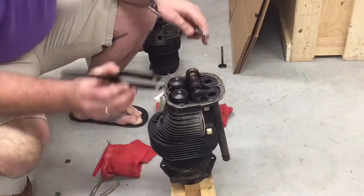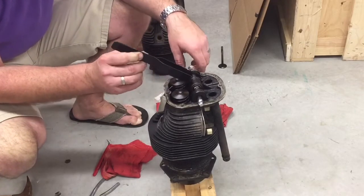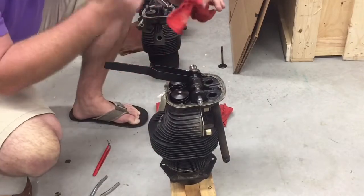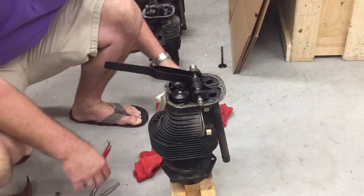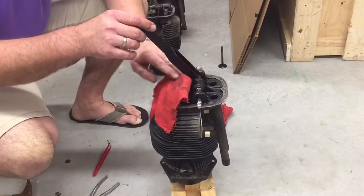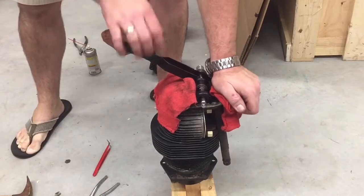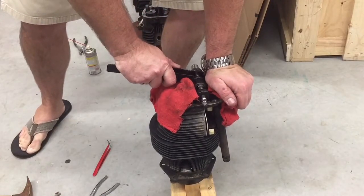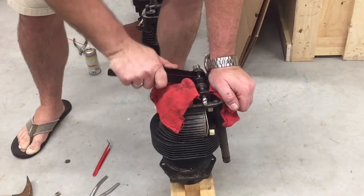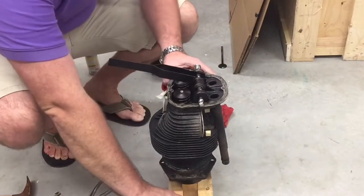Let me turn this around so we can see a little better. You take it, stick it down in here, and just slide the extension right on through like so. What this is going to do is push down on your valves right here on the lifter spring. I take a rag and keep this sharp edge of my tool from scratching up the top, and then you'll hold down pressure on the left side and push down with your tool until you hear it pop — just like that.